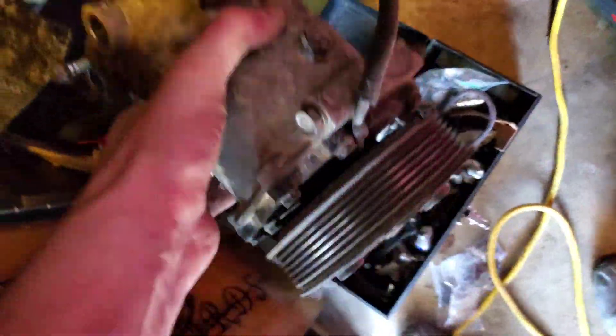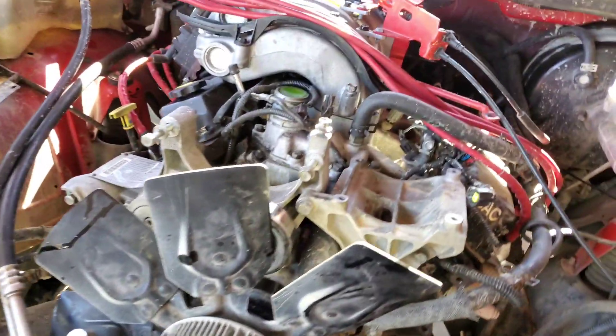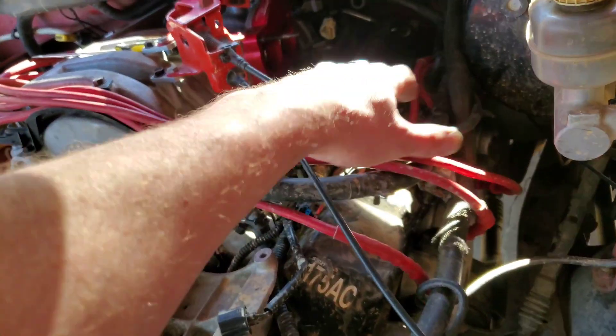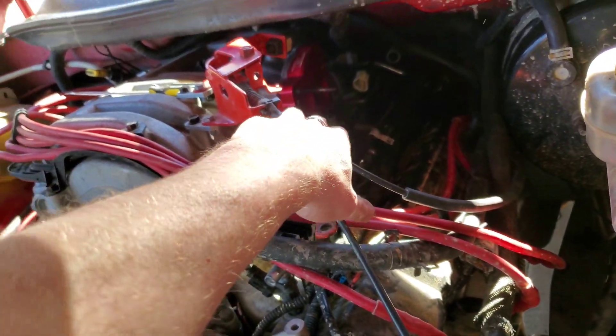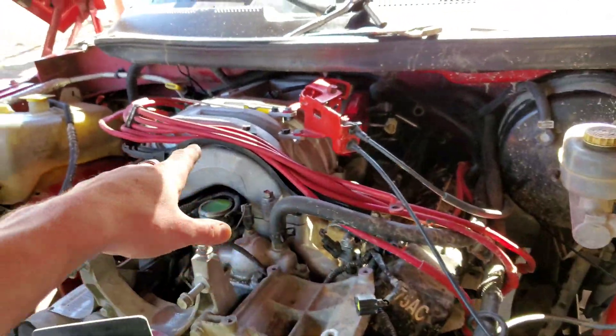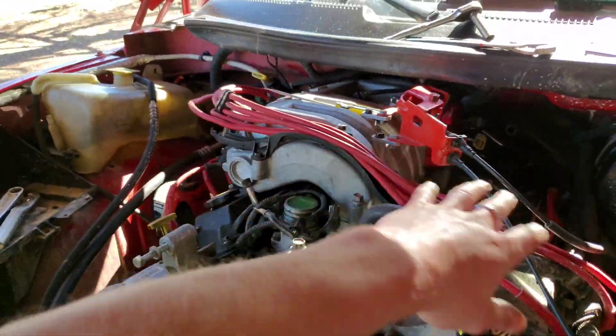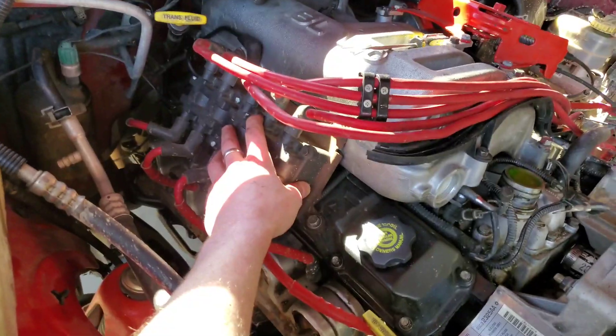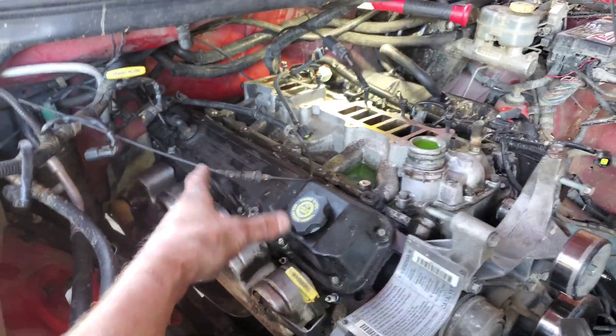These AC pumps really aren't that light. Once the AC pump is out, go ahead and get your throttle body — boxed throttle body, couple of plugs back there, four bolts holding that in. Also got to get this linkage, everything out of the way, unhooked. And can't forget — not throttle body, but coil packs.